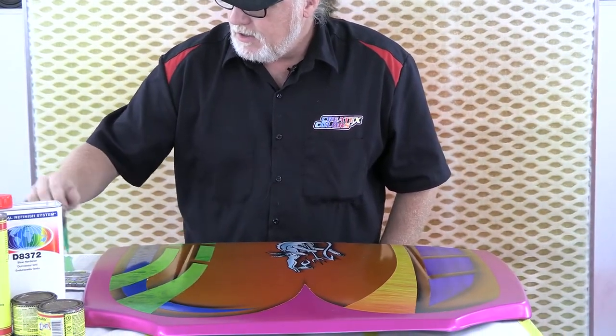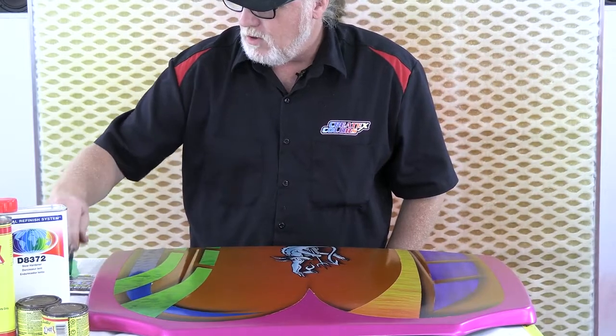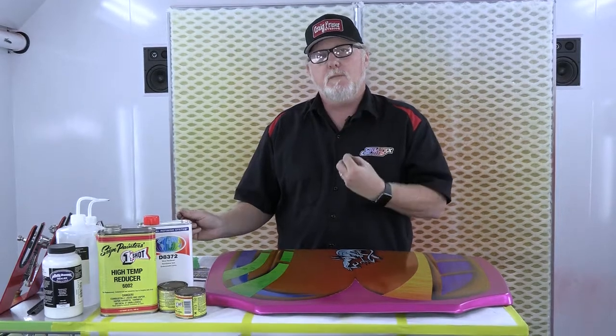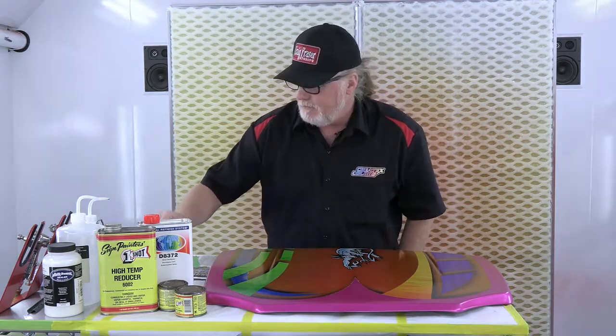Now I used to always ask people a trivial question: when would you use a magazine, and when would you use a phone book? In really, really cold weather, you use the phone book because it's more absorptive and it pulls some of that reducer out in cold weather. In hot weather, you need as much reducer as possible in there, so you use a magazine. So, neat little trick there.